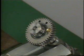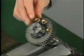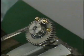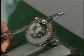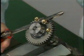To remove the subgear by removing the intake camshaft, mount the hexagonal wrench head portion of the camshaft to a vise using a protector made of aluminum or the like. Insert 2 bolts in the service holes of the camshaft subgear as shown. Inserting a screwdriver between the 2 bolts, remove the service bolt while removing the camshaft.